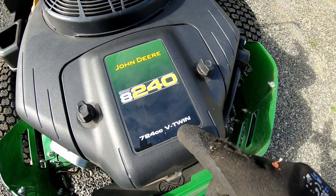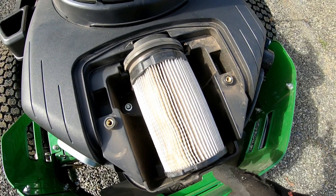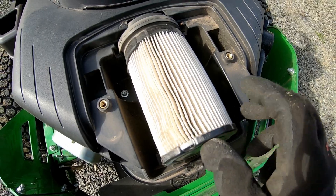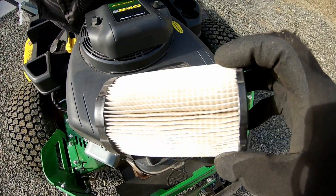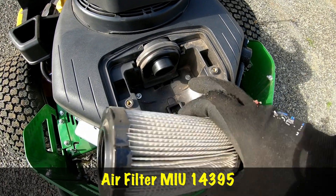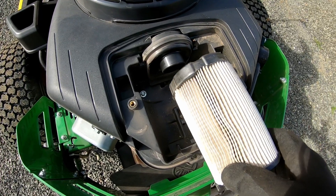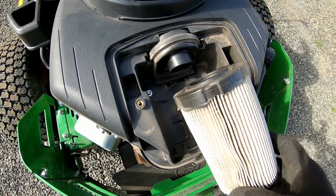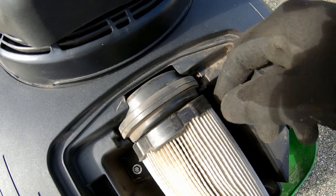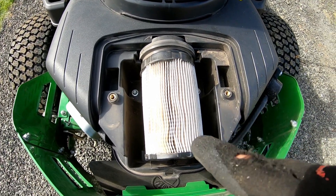We're just going to have a look at the air filter. I've actually cleaned this one not so long ago, but we'll run through what you need to do. Loosen these two little bolts, take the cover off and that's the air filter. It's held in place by a clip at the back which puts pressure onto a rubber seal at the front. Get the back with your thumb and just lift it straight up and it'll come out. You can blow that out with an air gun; if it gets really dirty you could replace it — this one's not too bad. Pay particular attention to the front seal on top and also here to make sure it's getting good contact. I have noticed it sometimes seems a little loose and it worries me that it's actually sealing up properly. To put it on, just line that up again, push it forward, click it in the back, and just make sure that seal is nice and tight. It does get a tremendous amount of dust at the back of the machine and this air filter gets quite dirty quite quickly.